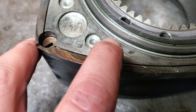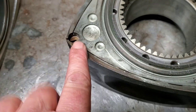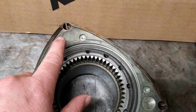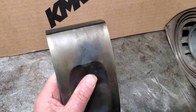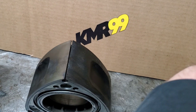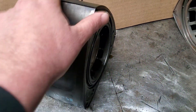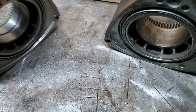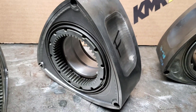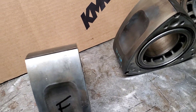This would actually be a late model rotor because you can see it's got the factory step down from the land area to the tip area. These are all factory balancing marks. My personal feeling is Mazda does not balance rotors side to side — they're simply balancing the front rotor to the rear counterweight and the front counterweight to the rear rotor. When you're talking about lightening rotors, you can see we remove a lot of that factory balancing, but we're just going to go ahead and balance on the counterweights. Maybe I'll have to do a tech talk about balancing.